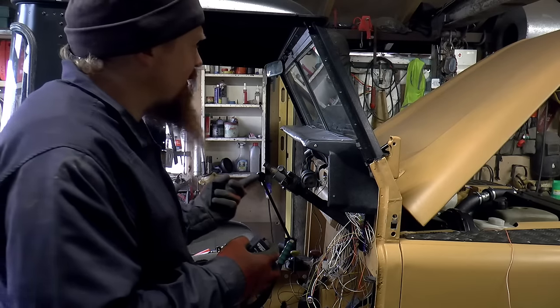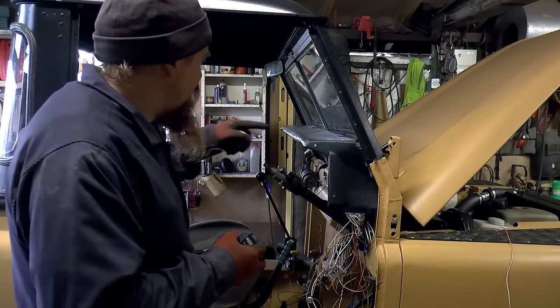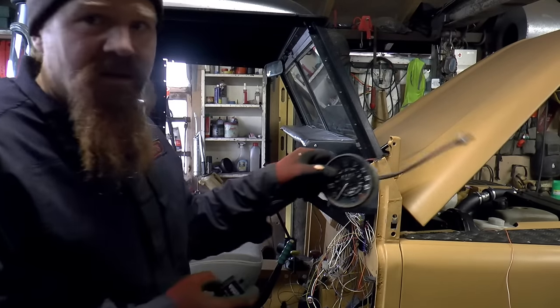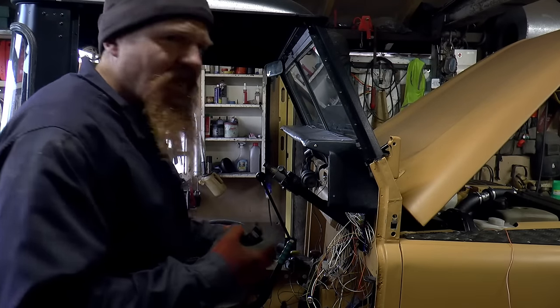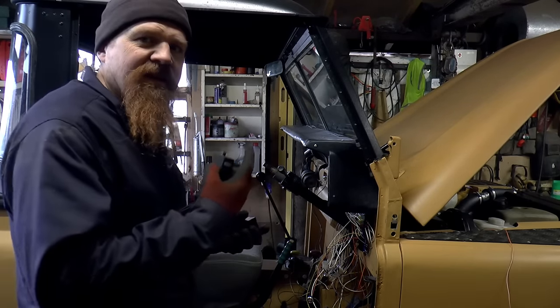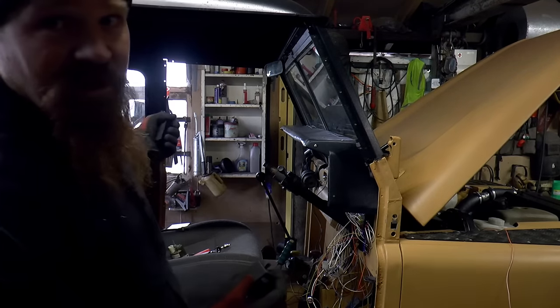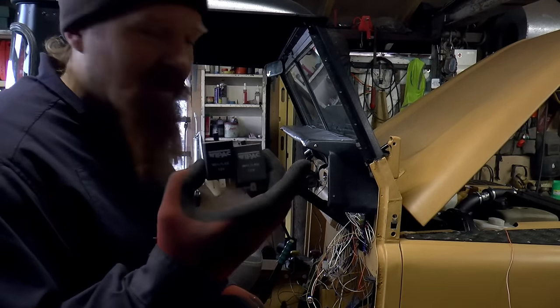And here I do have a mixture of both, in that they're all LED lights around the outside, and then in the instrument cluster, I can hear these little bulbs are going to be incandescents. But even if it was entirely LED, there will be a situation where I plug in a trailer board which will have incandescent lights in it. So anyway, these can cope with both types of lights.